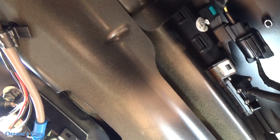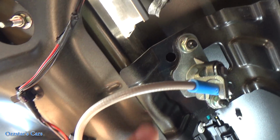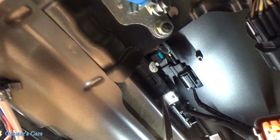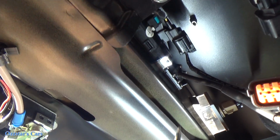And what you can do to the ones that you can see, now mind you, you have this latch in the way, this bracket for your trunk latch, that's the lock, you won't be able to push those back, but you can get like this one here, and then there's one on this side back in there. You'll have to push it in with a screwdriver, try to release as many as you can.